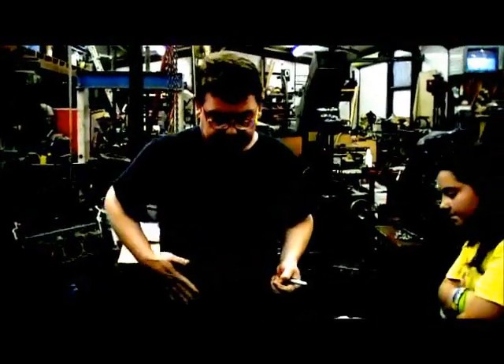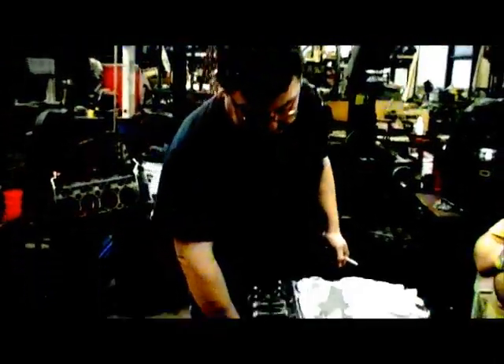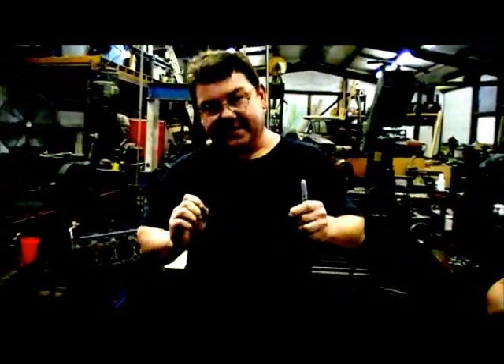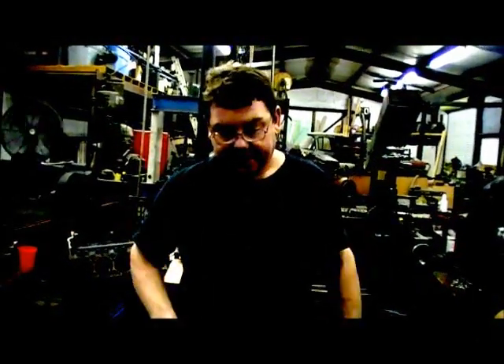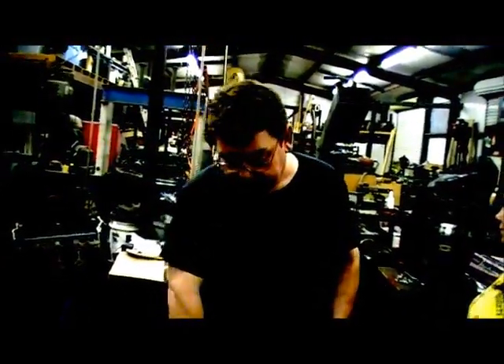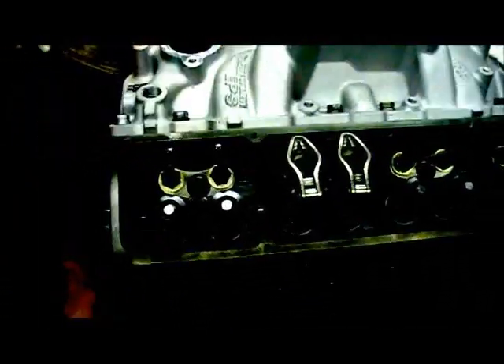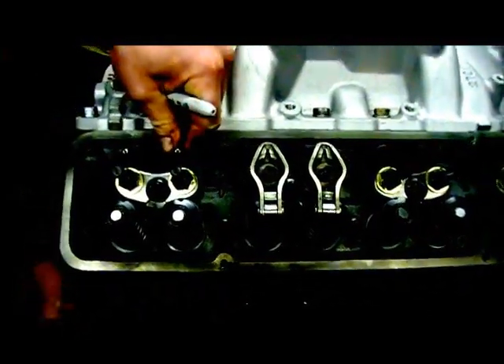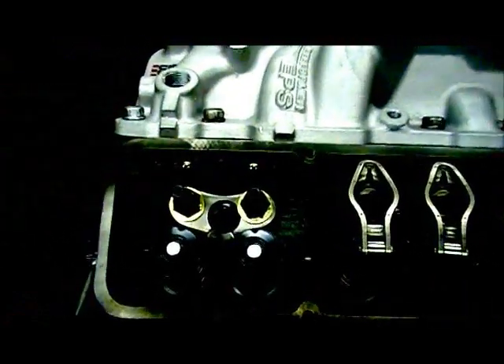The first thing you need to do is get your camshaft in the right spot, same as you're setting valves. I'm gonna do another video right after this on the correct way to set valves, because I have customers call me at least five times a week asking how to set valves. You set the exhaust valve when the intake valve starts to close. Right now the intake valve is starting to close, so we know the exhaust valve is on the base circle.